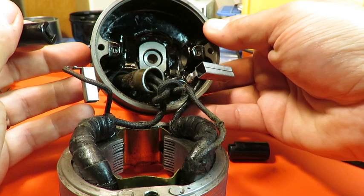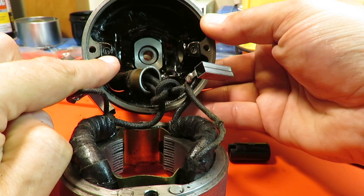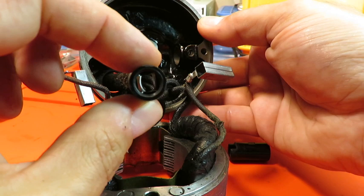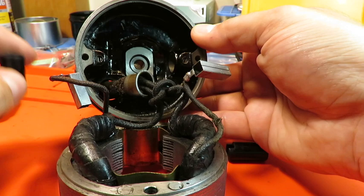The sheaths themselves have this notch on one side and the inside, and they have this flat spot milled into them, which sits behind this grub screw on either side, and which is what holds this in place from being rotated. Interestingly, when I took this motor apart, these screws were somehow loose, and these sheaths had been rotated from a sort of 90 degree straight up and down orientation to a sort of 45 degree orientation. And that has implications for how the brushes wear. I've since smoothed the brushes just a little bit so that they are a little more at right angles.